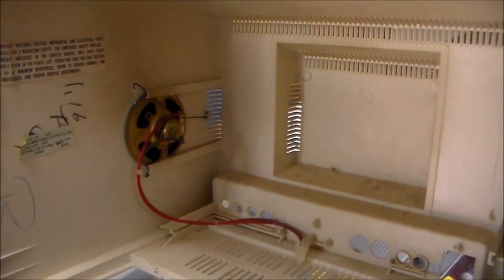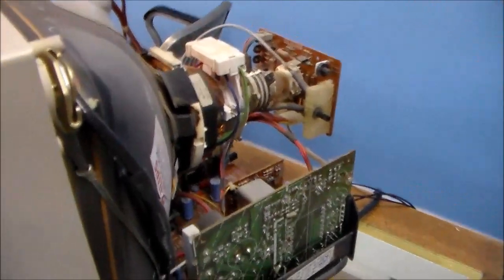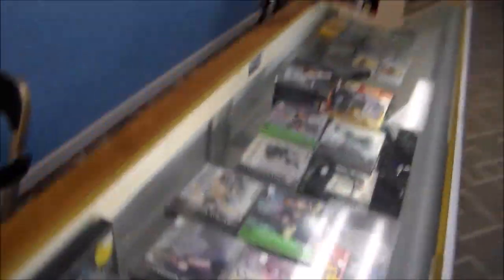So we took the back off, which was just four screws. Whenever you take it off, there's a speaker on the side that's plugged into the back — you have to unplug that and then you can take the whole back off. There are my four screws. Our retrace line issue — usually on an arcade monitor or a TV, which is basically the same thing, it's a CRT — that's typically an adjustment on the flyback.